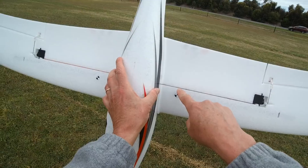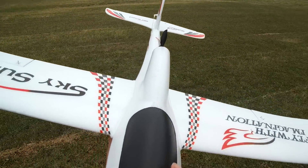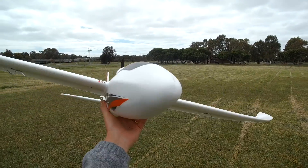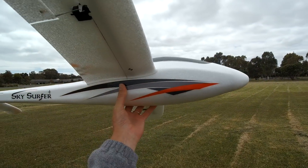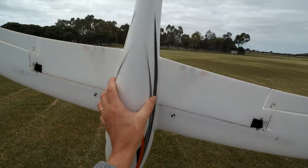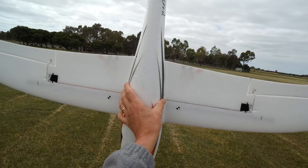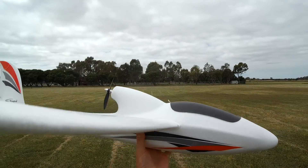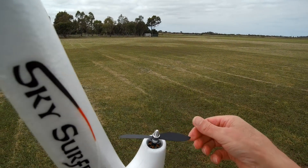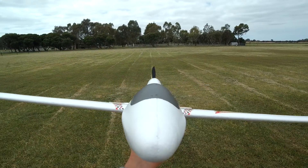So this is quite a surprise - I have the CG right back on those servo wires with a 1300 3S in there and it's flying perfectly fine. If you want more flight time you can put a 2200 3S in there - I still have 50% battery just from the 1300 3S, so flight times are going to be pretty lengthy. I reckon you'd get easily 20-25 minutes with a 2200. It's more of a glider than the Bixler 1 for sure - it really glides beautifully. That's due to its lower weight; at least 150g less weight than the Bixler 1 with the 1300. The under-cambered glider wings really make it a better glider and a better slow flyer. The motor's a bit noisy in the prop - not quite sure, it's just a bit whiny - and you can actually put a bigger prop on there, but it's very good as it is.